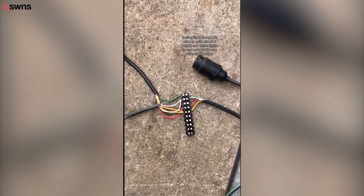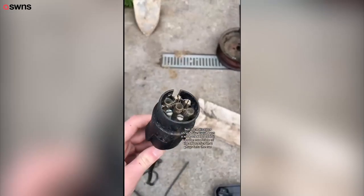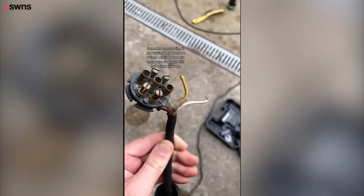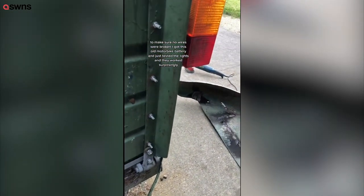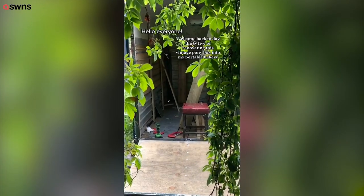Then disaster struck — like usual, I hit a setback. I thought it was the condition of the old socket that plugs into the car, but after unscrewing it and looking at the wires, I realized the previous owner had wired it wrong — wire 313 is yellow but it's supposed to be white. To make sure no wires were broken, I got an old motorbike battery and tested the lights, and it worked. I think even my dog was celebrating at this point.